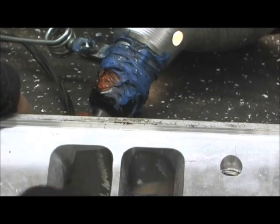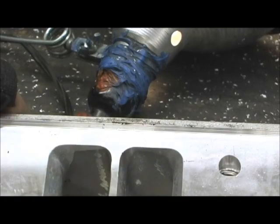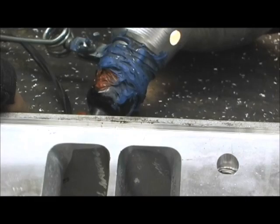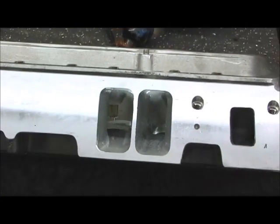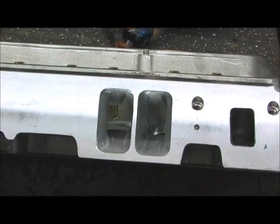I won't even touch that with my cutter because I'm just trying to get the giant humps and the funnel out of it, blend it, and hand it to them without any kind of polishing or anything. Just wanted to show you that last part. This wasn't near as bad as the exhaust - the exhaust is what was horrible. So now we're going to get on to the valve job and the bowl area and conclude this.